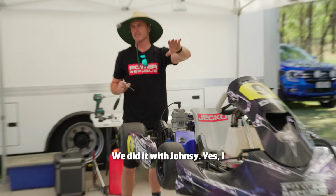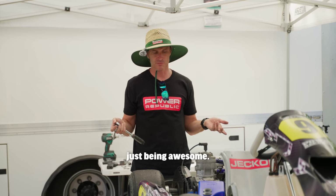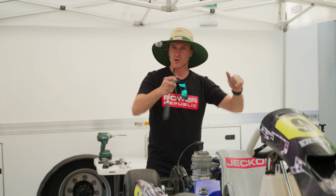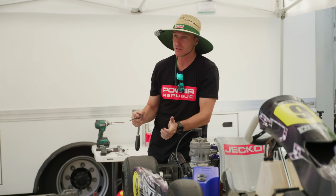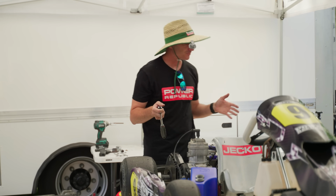We did it with Johnsy yesterday. I drove Johnsy's kart in the afternoon. He didn't make any changes either because he was busy just being awesome. And we left the kart in qualifying spec. And as soon as I drove it, I would just want to light up the rears. If I drove any harder into the corners, the first thing I felt was oversteer. Okay? So that's one thing I want you guys to focus on when you're driving.